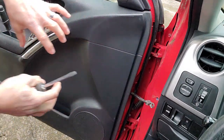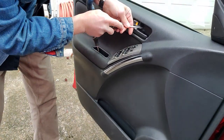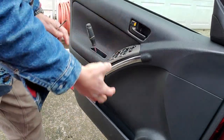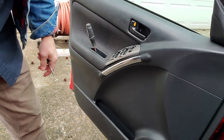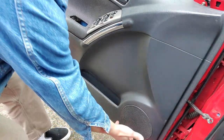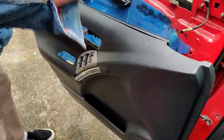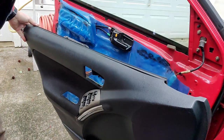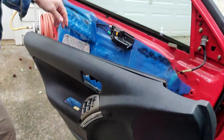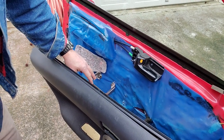We don't have to take the panel off all the way, but you do have to kind of pull it back some. There's a Phillips head screw right here, and then with a little flat head, pry off this little cap right here. There's another Phillips right behind there. Remove those screws, then you'll be able to pull the door panel back. The door is secured with little push rivets, so just firmly pull back on it, then lift it up over the edge of the window area. This also gives you a chance to check any screws, nuts, and bolts up inside here.